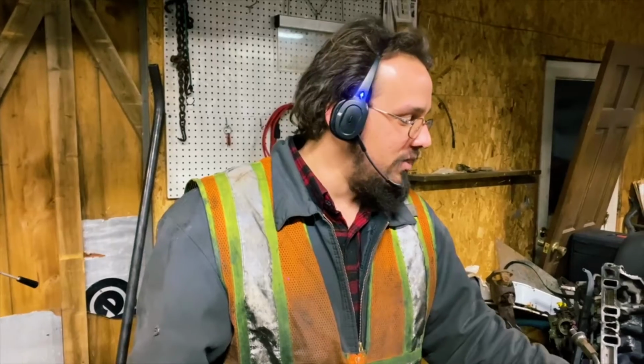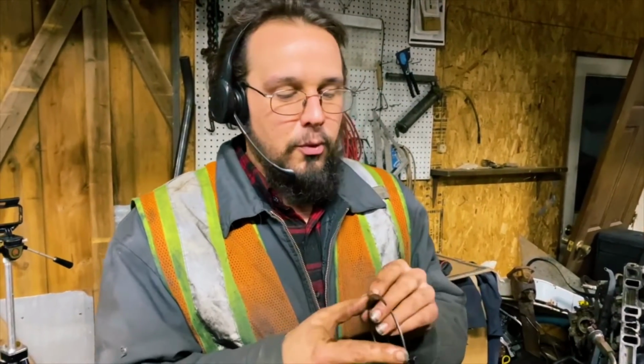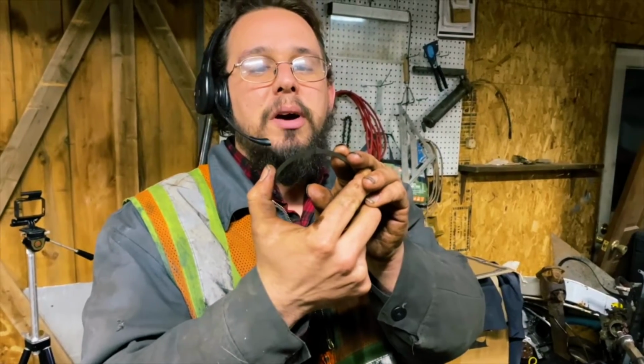So there's our little one shot on how to do the piston ring gaps and why piston ring gap is important. Well, it's important for a couple reasons. A, this engine may see only E85 with the turbocharged application. Even if we were leaving it NA, it would probably see E85. Well, with E85 comes more cylinder heat. With more cylinder heat comes more expansion. So the more that this thing heats up, the closer the ends of this thing will come to butting together.